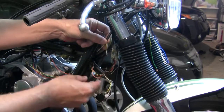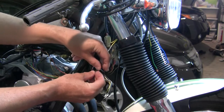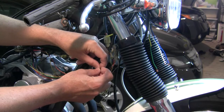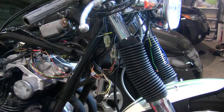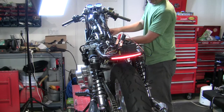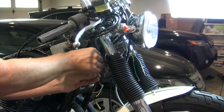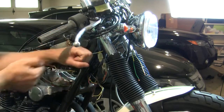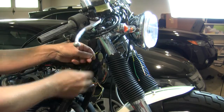These are the two yellows that I'm going to be hooking up with the orange and the white. Just to confirm these are indeed the correct wires, all I've got to do is put them together and we'll see the brake light going in the back. My wires are a little short here — I could stretch it and make it work, but I'm pulling on the wire and I don't want to do that. Plus, this is going to turn, so we want to have a little bit of slack. I'm going to have to extend these wires a bit.